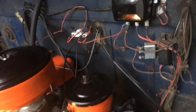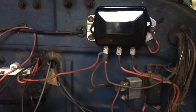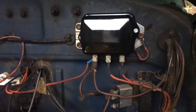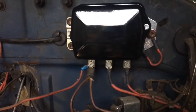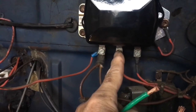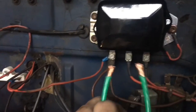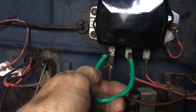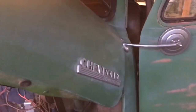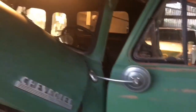I've wired in the new regulator here. Luckily I was able to get a good Delco Remy, good American-made regulator. So what I'm going to do now is polarize this. I'm going to jump from the battery side to the alternator side — you need to use at least a 16-gauge wire or bigger; I've got some number six, some real big stuff here. Never go over to the field — just these two terminals. If we see a little momentary spark, that's okay. Okay, that was it — just a little one-second spark. I'm going to go ahead and fire it up. You guys are along with me for the first time here, so hopefully we're going to be charging after this. This will be its first startup.